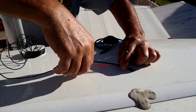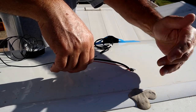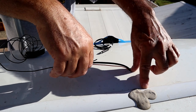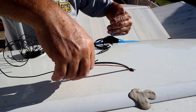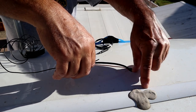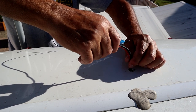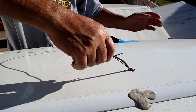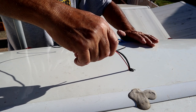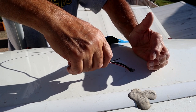A hole's a hole — if you don't seal it properly, you're going to get water in there. I am two and a half inches from the seam where the fiberglass goes straight down, where the main body of the RV meets the cowling in the back. I think this is a pretty good position. I could just connect the cables here, seal this up, and attach the camera, but I don't want this wire flapping around from here to the bottom of the RV. So I'm going to attempt to attach it to the fiberglass inside — that's going to be a little tricky, but I'll show you how I do that.